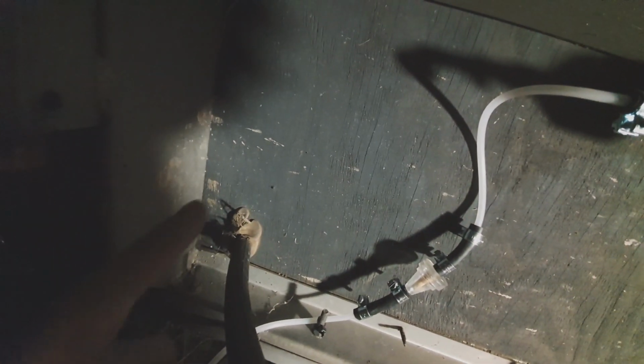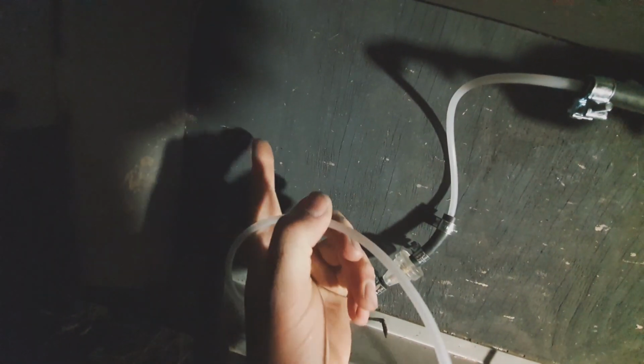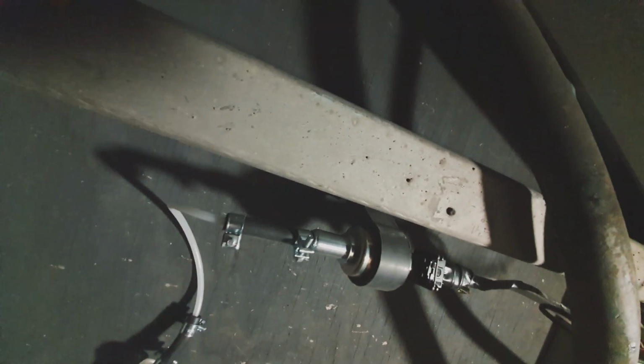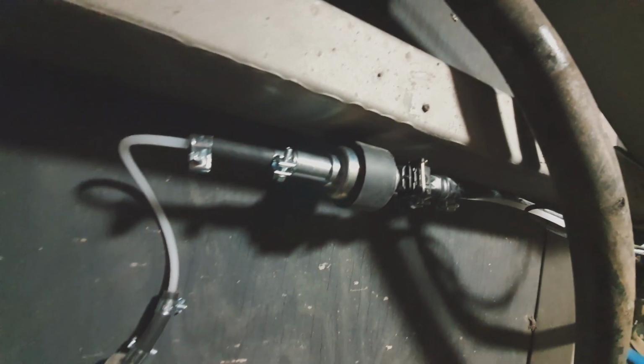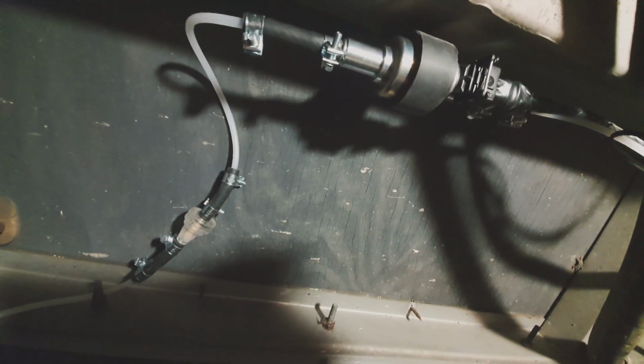Then what I think right here in this area, that's right underneath the storage container where the fuel tank's going to go. So this fuel line, the excess here, is just going to go straight up through the floor and into the fuel tank. So all it's left to do is install the fuel tank and give it a run, because everything else is connected. I should say that there are arrows on the filter and on the pump, facing the way you want the flow to go, so towards the heater, this way, down the Caravan. Yeah, don't ask me how I know that.